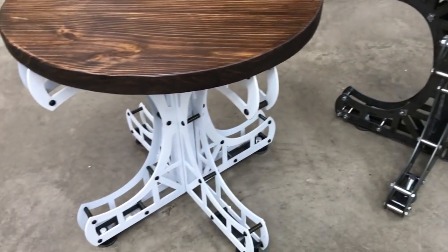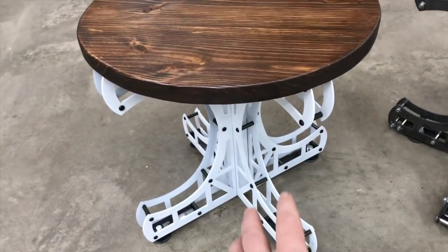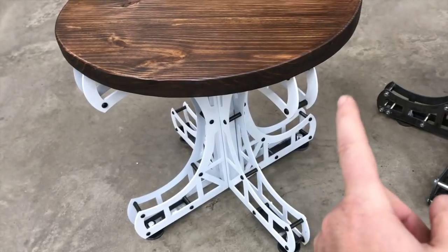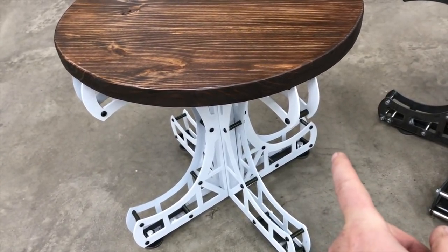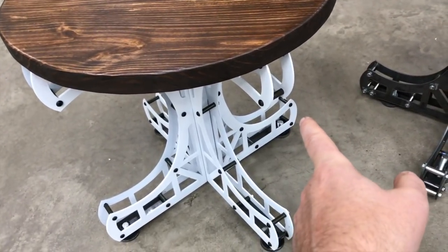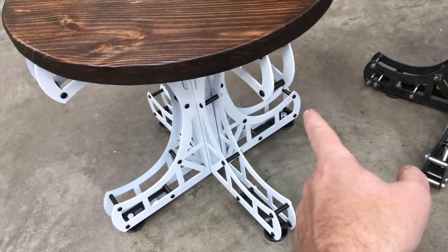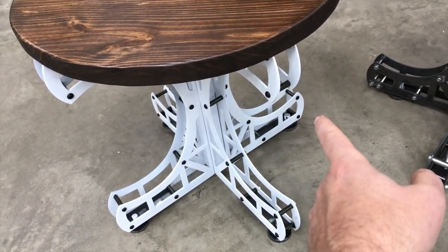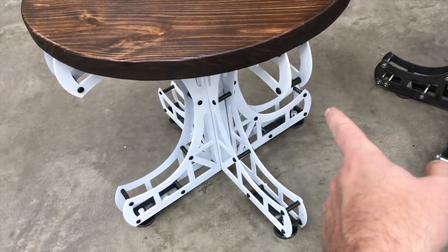Anyway, just want to clarify, if you buy the kit, it's not going to come with the spacers and bolts, but you will get links to where to purchase those. Your cheapest options are going to be one of two things. One is if you can cut these down. The brake lines, these are just 3/8 regular brake lines. Go to O'Reilly. I think it's about $6 to get enough to do that with.